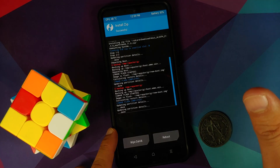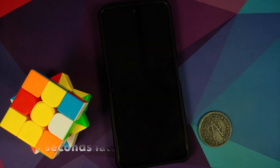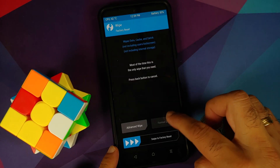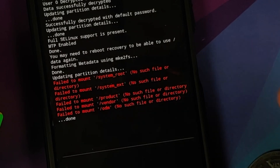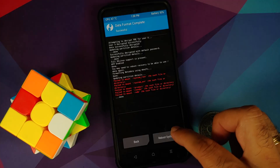Tap the home button, go into Reboot, and select Recovery to go back into TWRP. Then go into Wipe, Format Data, type 'yes', and tap the checkmark on the bottom right. Note that format data will wipe all your pictures, videos, and anything important. It may take some time — be patient. Format data completed without any errors. Any errors about failing to mount partitions can be ignored.